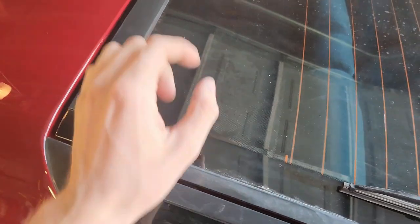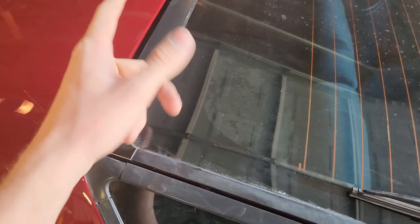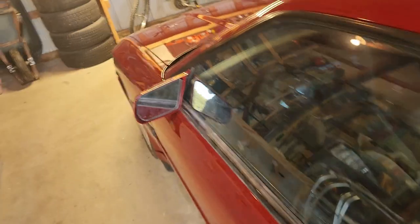I forgot to do it, but I need to buy some 4-0 steel wool and get this overspray off the glass. See right there — some right there, there's more overspray back there. I was at the parts store today but like a big dummy I forgot to buy it, so I gotta pick some up next time I'm there. That's not a big deal. Just take some 4-0 steel wool and softly go over it. Make sure it's 4-0 — if it's any lower grit you can scratch your glass, which isn't great.